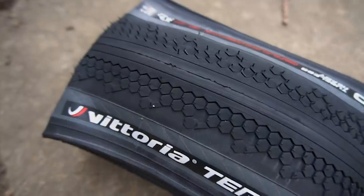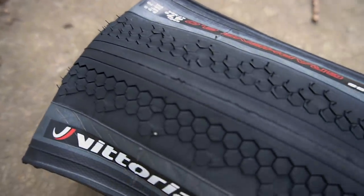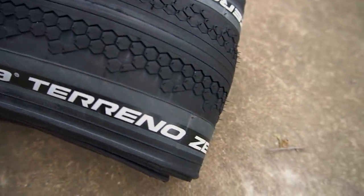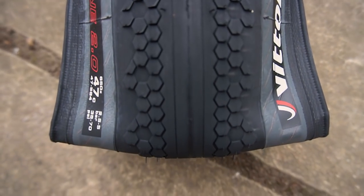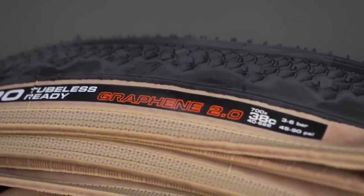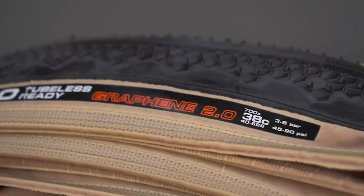These aren't the fastest tread-free gravel tyres, but they're not slow either. The plus side is that they're incredibly robust and can romp over packed gravel paths, performing a lot better than you might expect over rougher surfaces. Mechanical grip from tread only increases traction when the tyre can actually dig into the surface. On rocks, tarmac, and hard-baked earth, grip is determined by the tackiness of the compound. These tyres use Vittoria's graphene compound, said to allow no compromise between speed, grip, durability, and puncture resistance.